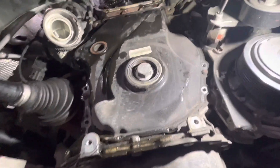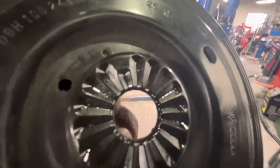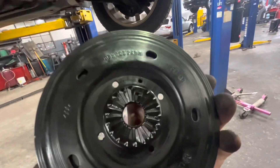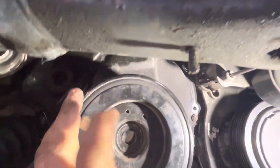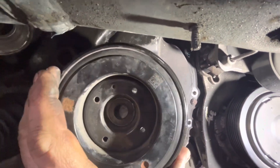Also, when you're putting the dampener back on, be extra cautious. This wide finger up here has to line up — you'll see it's pretty obvious when you have this thing spun up where it should be. It'll be directly on top, lined up with that sticker, and that'll line up with the large tooth. When installing it, this little hole here is also exactly in the same position as that finger. So when you go to put it on, just make sure that hole lines up with the wide key on the sprocket before you push it on and before you tighten the bolt. That's it, thanks for watching.